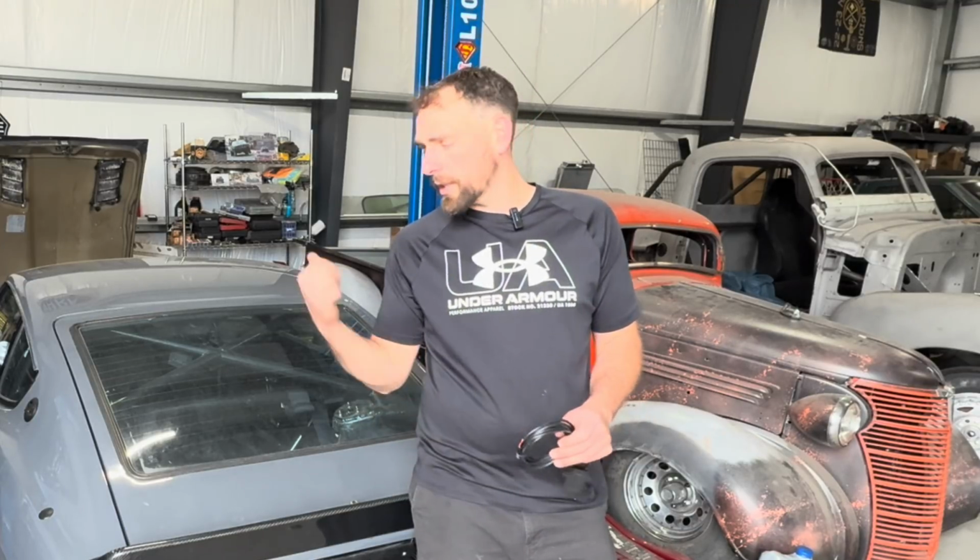All right, so previously, going over the electrical on this electric steering system that I installed, I did have it wired to a switch to test it out, which you saw. There's very fluid turning. It's nice. You can one finger turn it when you're sitting there. It's great. However, you don't want the power assist all the time, because when you're racing, you don't need it that smooth. That's way too smooth for power assist.